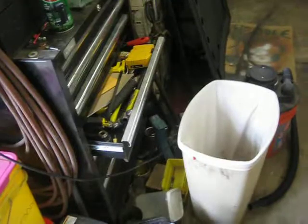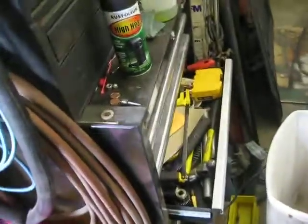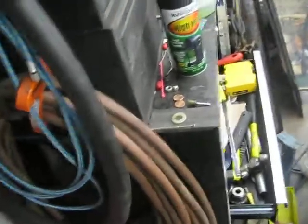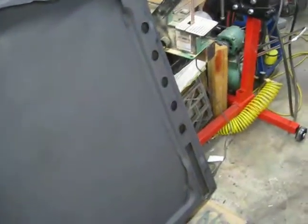I just pulled the plug and let what was in the bottom of the pan drain out, and then plugged it back up, filled the radiator back up, and then I actually spun the water pump over with a drill so that it would get a little bit of water pressure. So if there was a leak, it would fill the crankcase back up. But I undid the oil plug again, and it was only oil that came out. So apparently the head gasket is good, so that's pretty awesome.